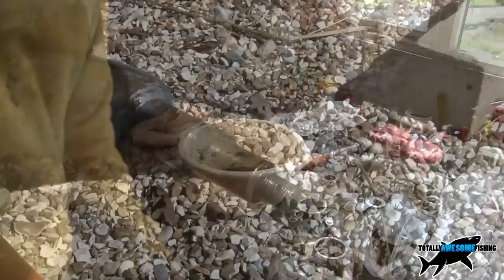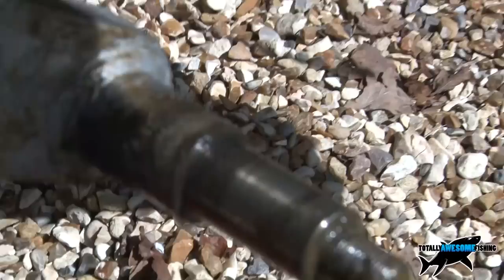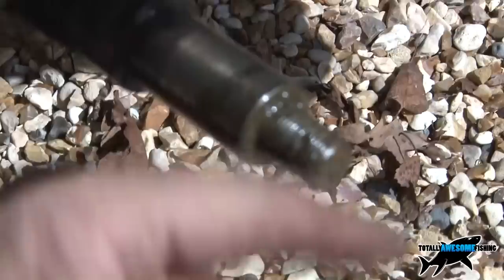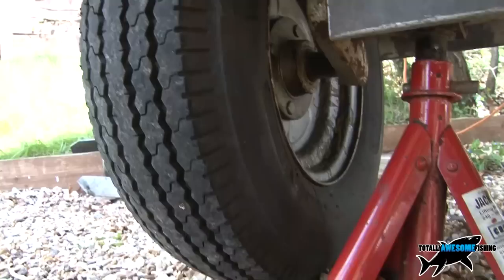Okay guys, I'm still in shock from seeing the internal sleeving on that bearing. If you remember earlier I mentioned there's a mark here, and I think that's heat build-up. I can now see that black mark is exactly in line with where the heat build-up has come from — where it's all pitted, the inside of those sleeves are pitted and corroded away. Watch out for those signs on the shaft. The shaft's smooth, it hasn't hurt that, but I'm going to check the other side out because I've got a very bad feeling.